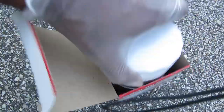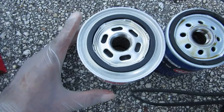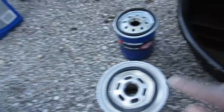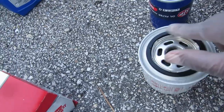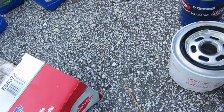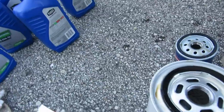What's going on people — I'm back from the discount auto store. I got the actual correct filter for it now. This is the filter that's supposed to be on it; this is what the lady at AutoZone sold me — STP — and look at the difference, it's night and day. Before you put it on, always grease up this black rubber gasket rim. Take a little oil and grease it up — just a little bit, not too much.